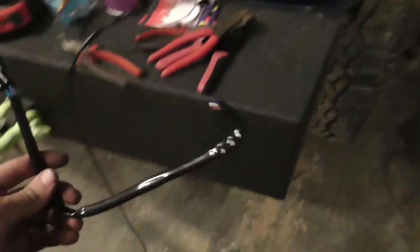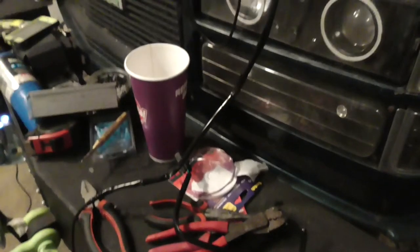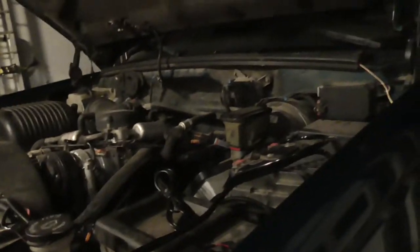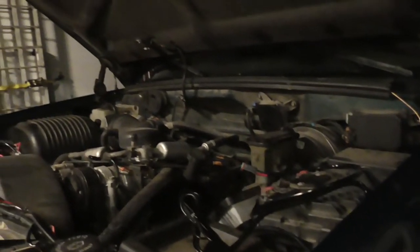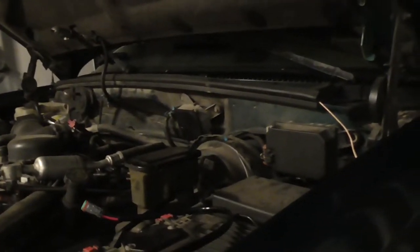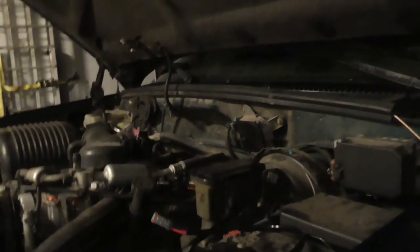And then all I got to do after that is find out where I need to cut it, then do another solder joint for up at the top. And after I do that, lengthen my power wire, my Deutsch connector power wire, bring it up to the top. And then all I got to do is run a switch inside, which I don't know if I'm going to actually wire up tonight. I'll probably do what I did in my Jeep. Run it inside, put it on top of the dash, and mess with it tomorrow, because I'm off tomorrow. So I'll finish wiring that tomorrow.